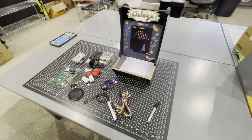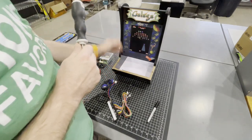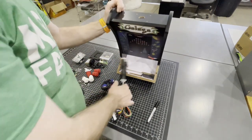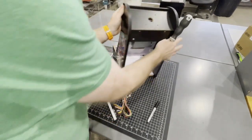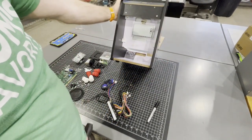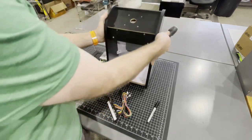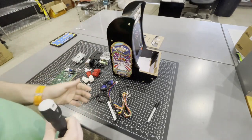Good afternoon, Shane from DIY Retro Arcade. Today I'm going to show you how to install the 60-in-1 kit on the Generation 2 countercades. To get started, you'll need to take the CPO off, pull out your factory speaker and set it aside as we'll use it later, and then empty out the back as well, so you'll end up with nothing but a shell.